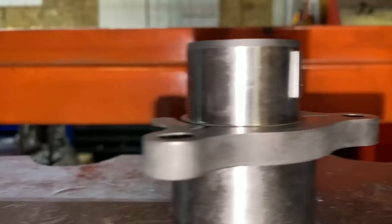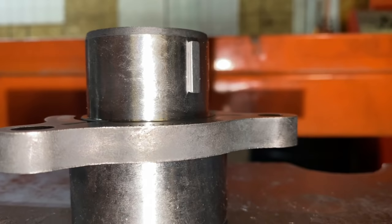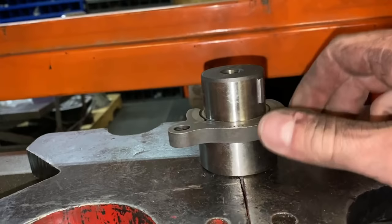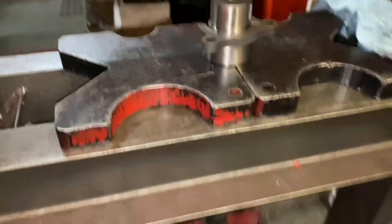And then one thing you wanna always double check, because I've had this before, make sure that the cam sticks out a little past the thrust plate. I have had a couple of Hamilton cams show up that were a little bit short here. This one doesn't seem to be a problem. We do have a little clearance, but you'll know, you'll press the gear on until it stops and this won't spin. Okay, when installing the cam gear, make sure it's clean.